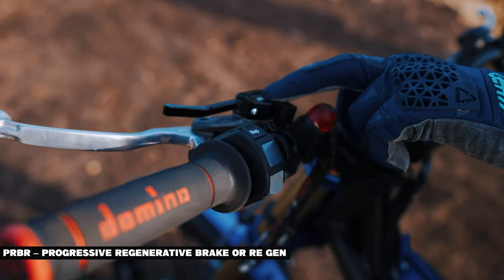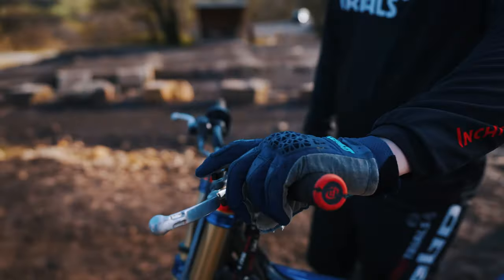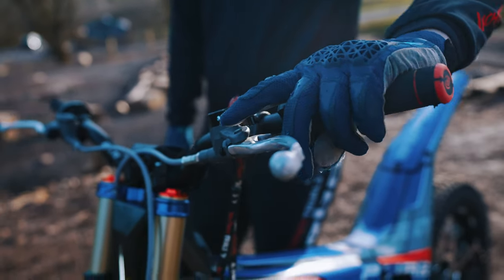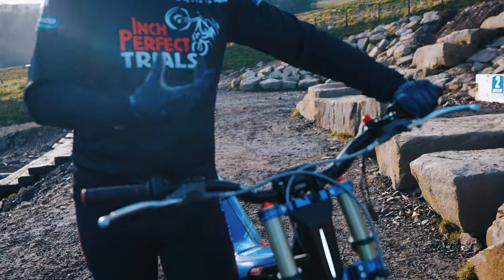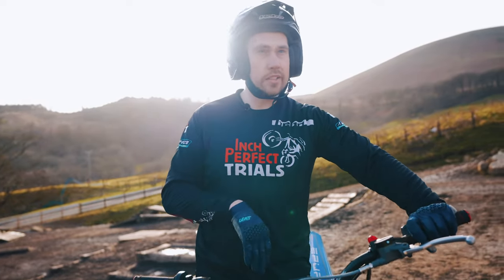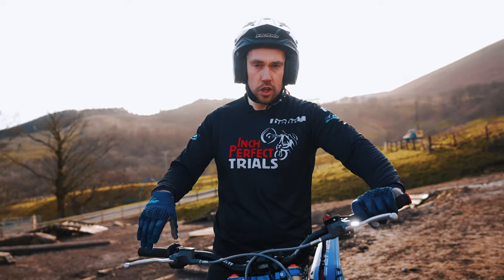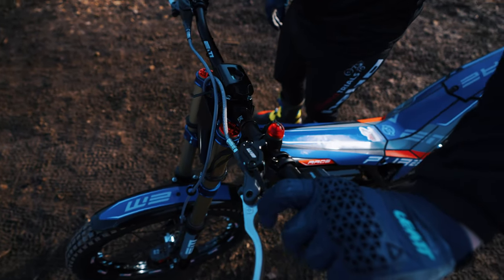An optional added extra is the PRBR — 99% of people go for it and for me it's a no-brainer. It's a regen brake lever: pull it a little and it brakes a little, pull it a lot and it brakes a lot, while putting power back into the battery. I use it 95% of the time and I'm 20 to 30 percent better off on battery by the end of the day. The difference from the rear brake pedal is that this brakes through the motor. Pull it right in and it won't quite lock up the wheel but slows it right down. In wet and slippery conditions, particularly in the UK, you can easily lock up the rear brake pedal — but with the PRBR you just leave the rear pedal alone, pull this right in, and combined with your front brake you can come down a hill nice and controlled.